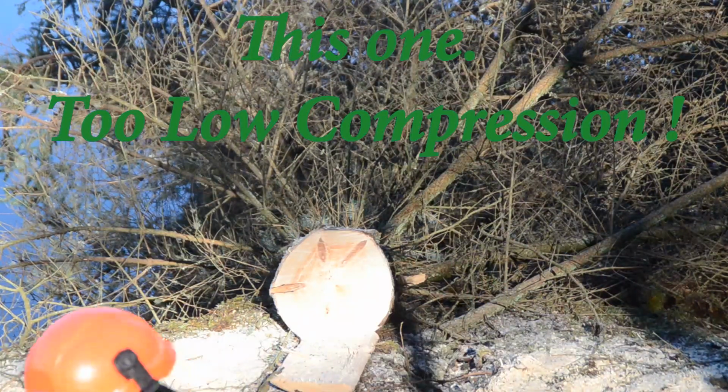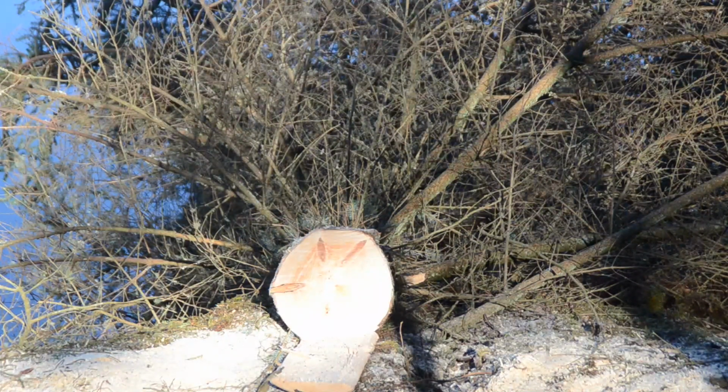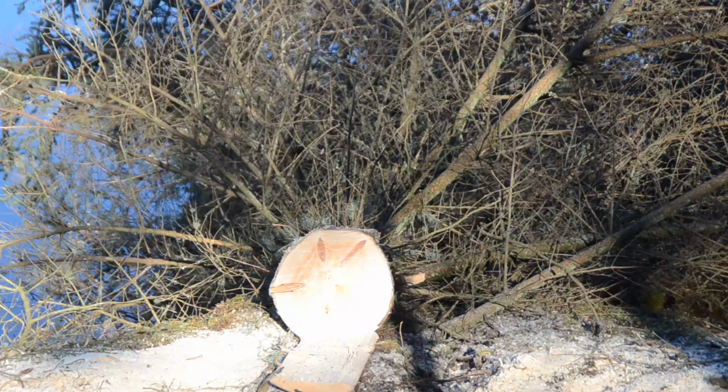It's wet because it barely starts when it's dry, and then it works fairly okay. But it has too low compression, no doubt about that. But it's pretty easy to work on, so it's no big deal to change the piston and cylinder on that one.